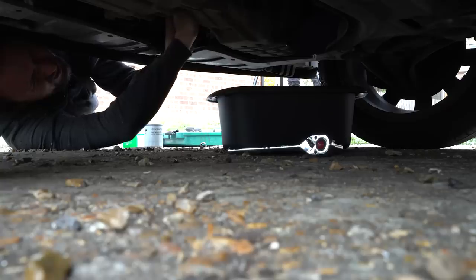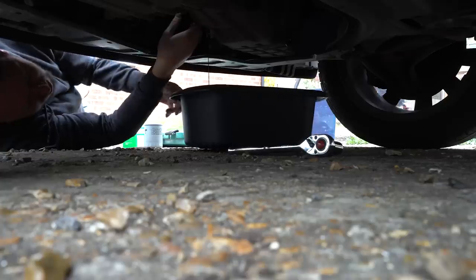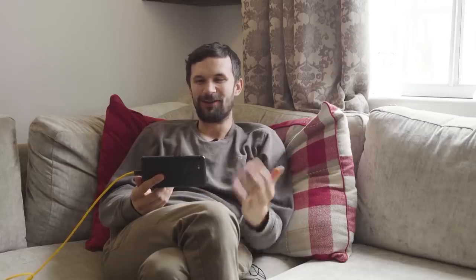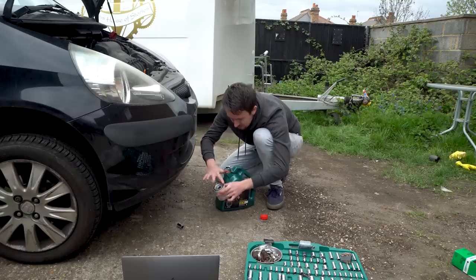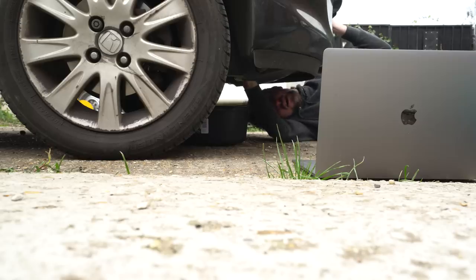What do I do now? Well, you could get the oil filter off. I've got eyes on her. It's coming — bear in mind a little bit. You absolute arseholes. I knew it was going to start dripping. Does the name 'oil filter' not suggest that it's going to be full of oil? Why are you trying to screw me on this? You're supposed to be helping. Right, your next step, Ethan — you want to put your new oil filter on. But before you do that, you want to get a little bit of your new oil and rub your finger around the rim. Just gently around the rim — hand tighten it, don't go crazy on it, but make sure it doesn't fall off.